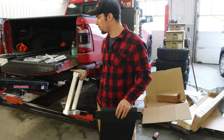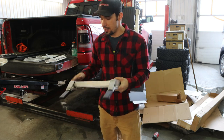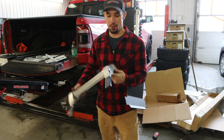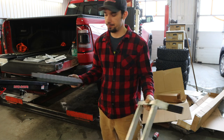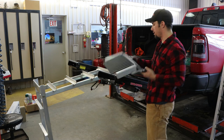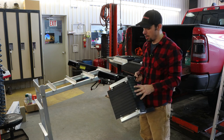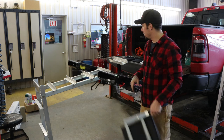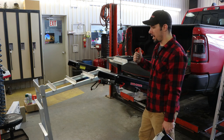Now that we have the center ramp done and the pedestal set up, everything else is pretty much ready for reassembly. The last portion is where this meets the ramp and goes over the gap of the truck box, so everything is covered and your truck is fully protected. This is the transition piece that goes from here to the actual box of the truck. We applied a little bit of heat to this because the fitment was kind of off — just enough to fold it over nice and have it perfectly flush. Very happy with that. We tighten everything up, torque, and apply a little loctite here and there, and then we're going to pull it outside and show you the complete thing.